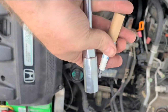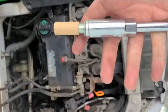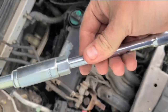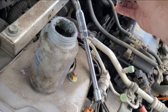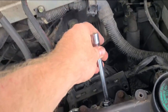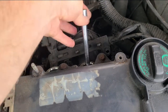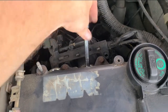Here's a new spark plug — get it in the socket. New spark plug in the socket, take the protective cover off, and we're going to put on just the smallest dab of anti-seize. That should be all you need — in fact, that's probably too much. Then we'll go ahead, insert them by hand — make sure to insert them by hand. Thread them down, and then we're going to torque them — I believe it's 17 pound-feet.